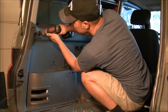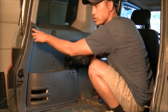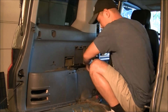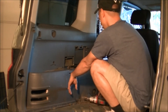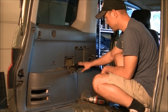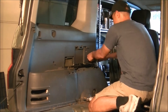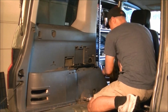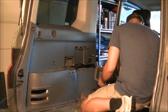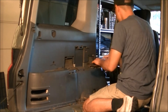There's a little plastic cover we'll need to pry off. Underneath here, take out that little hook and you'll see another screw. There's another screw right here, and that's all the panel screws. Now this chair support bar — take that off with the same number 14 socket wrench. There's a screw here, another screw here — these are actually bolts.